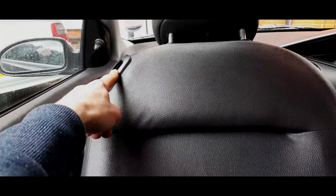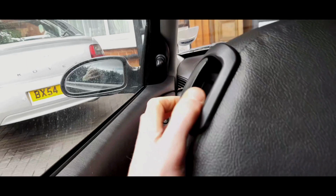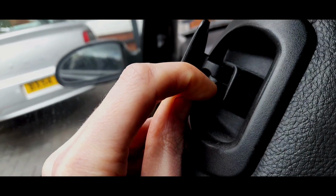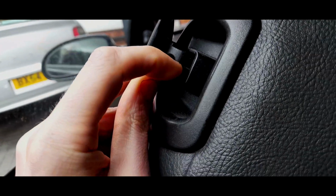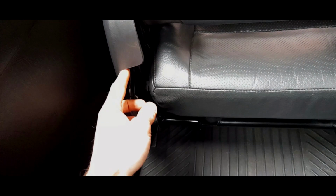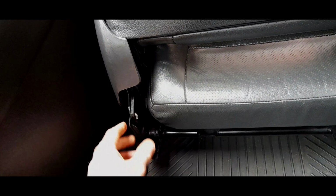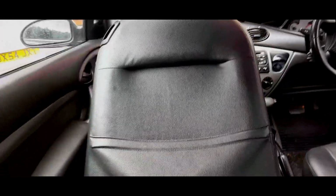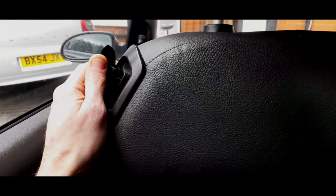This piece, where the cable links onto the handle here, okay, you've got this socket where it just sits in the actual handle, right? That cable stops around here. And then there's a little section here. But I would just make sure that all this, just spray GT85 up to here, okay? Go right inside and you will never have any issues, I can assure you. Even the most heavy-handed of people would not break this.